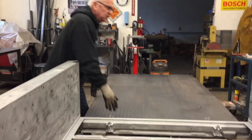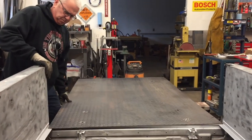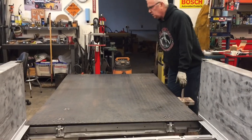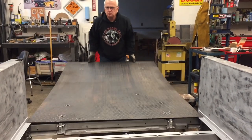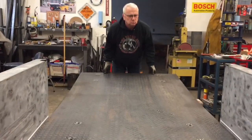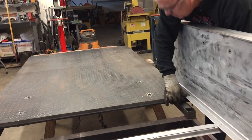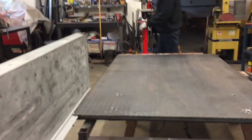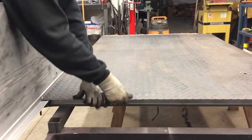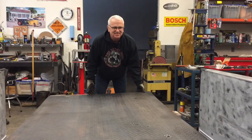So now I'm going to slide this up in here. There's a bolt head here that you have to put in beforehand on these trucks. This is a little carriage bolt that is for one of your fender braces. If you don't put it in now, you're not going to get it in later, because the steel is in the way.